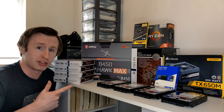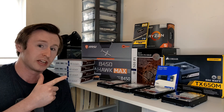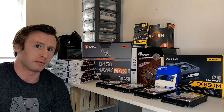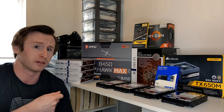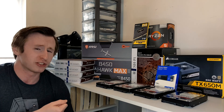I've gone with 16GB of Corsair Vengeance LPX 3200 speed memory. With ZFS it is generally recommended to have 1GB of memory per terabyte of storage, which is why with 16GB of memory we have 4x4TB WD Red drives. So 16TB should cover me for quite some time with the possibility of expansion further down the line. For our boot drive, I managed to pick up a WD Blue SN550 250GB NVMe drive, which I got for about £30 — pretty good value for a 250GB SSD.